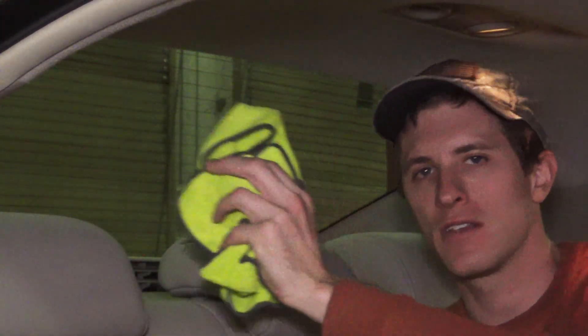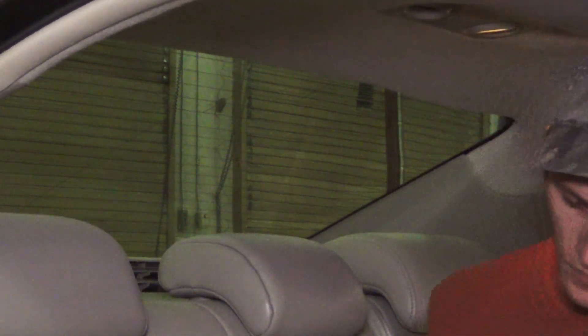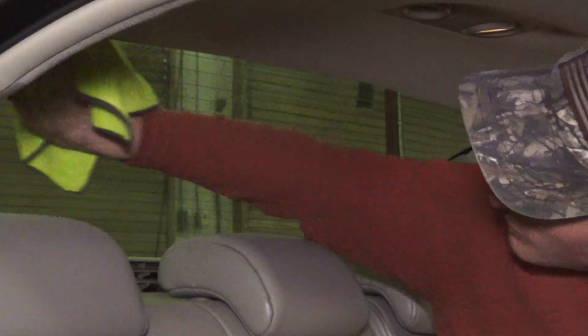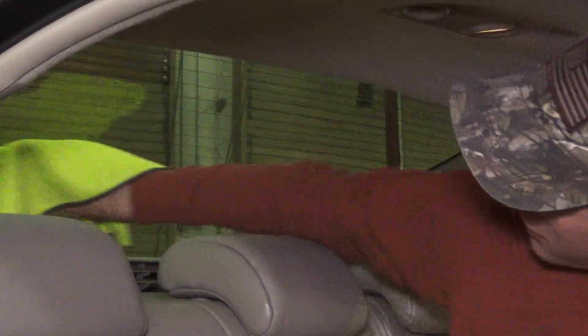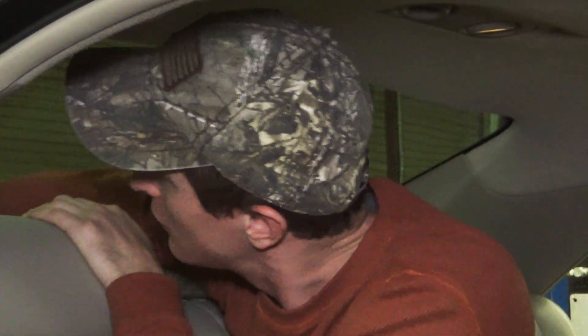What we do is always wipe with the coils in the back glass. I'm not going to spray directly onto the glass because it's quite a deep rear window. We're going to soften up any schmoo on the glass carefully. This is tinted, so technically it doesn't matter which direction you wipe because the tint film is applied over the coils — so I'm free to wipe up and down. But if you have clear glass, you really need to wipe sideways.